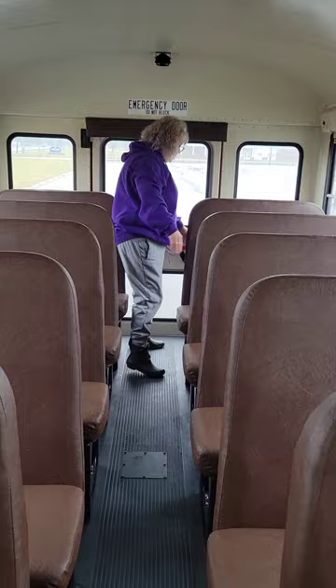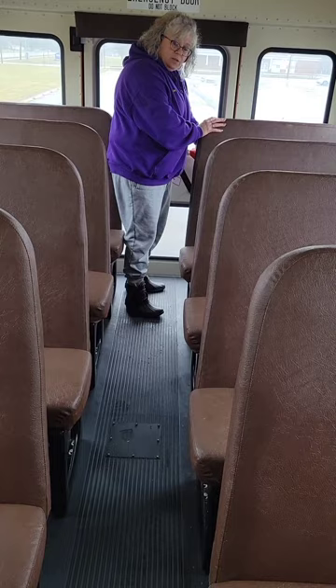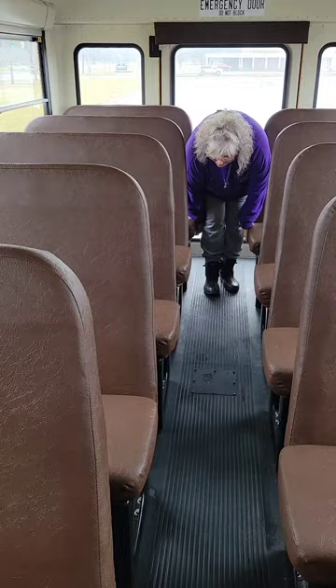Push my reset button — that cancels it. If you don't have that system, you can do this a little differently, but this is how I do it for this bus. When I lift the lever — the red lever, could be black on yours — lights and buzzer come on. Door opens easily. Close the door, close the lever, lights and buzzer go off. Check your seats — you want to check the backside of the seats on this one, make sure that they're secured.